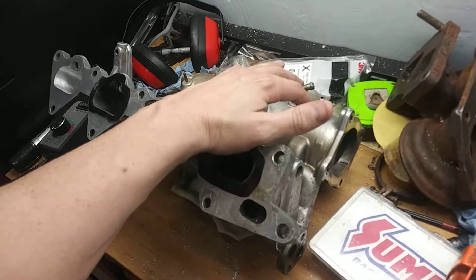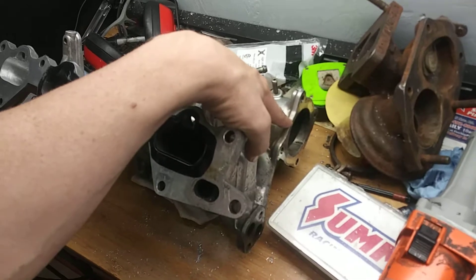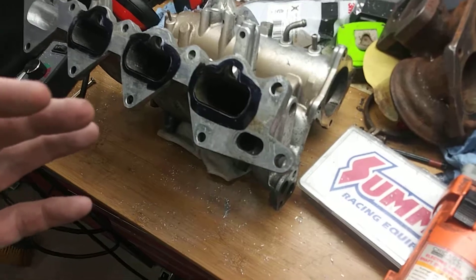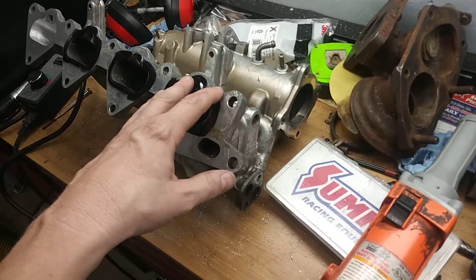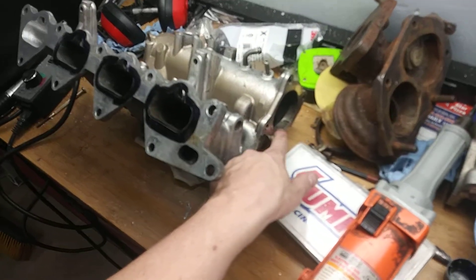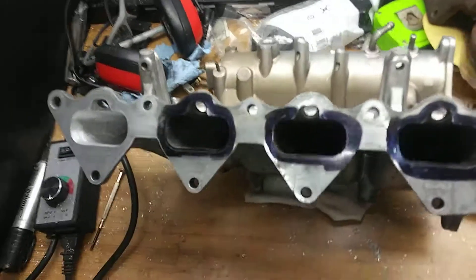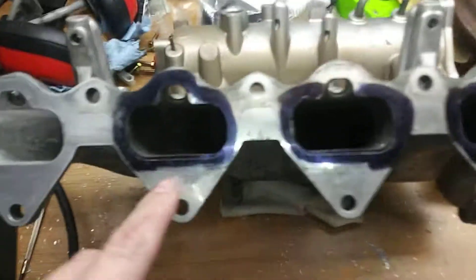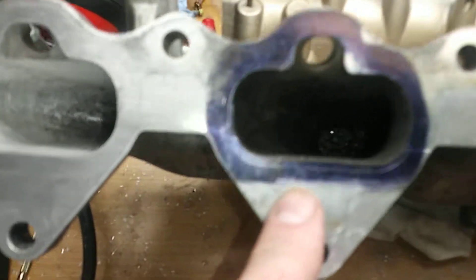When I put the FPRED on, I'm also going to put on the intake manifold and a 65 millimeter throttle body. The factory throttle body has a hundred thousand miles on it — it probably has some leaking seals. So while I have the seals replaced, I also want to have it ported out to 65 millimeters to match the throttle body. And I'll also port match these runners to the gasket — I've already marked on the manifold where I need to port.